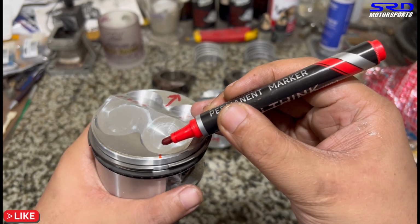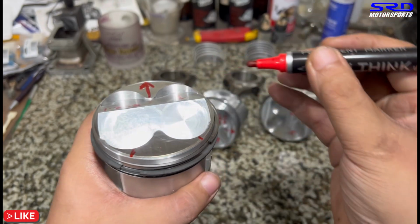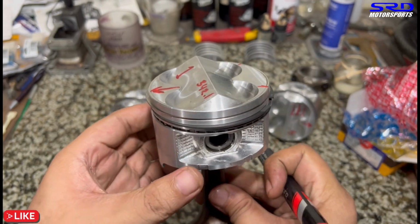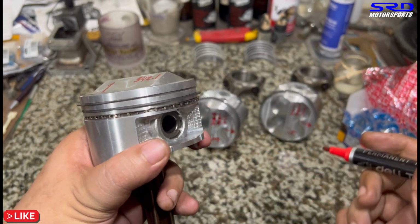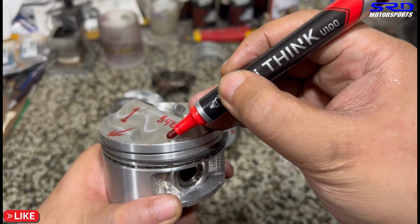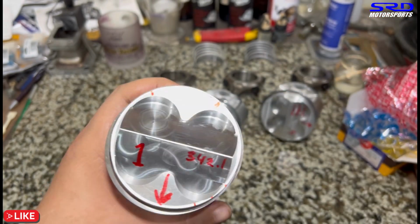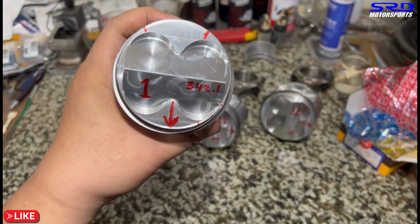Okay, piston ring number 1 is here, the top ring. Number 2 is here. That's the intake side. And then on the exhaust side, the scraper, the expander, and then the spacer here. There. So it's just like the manual.